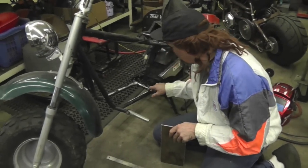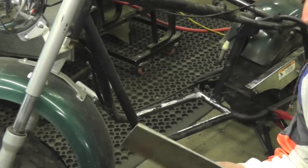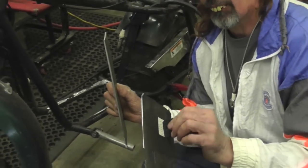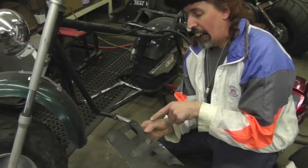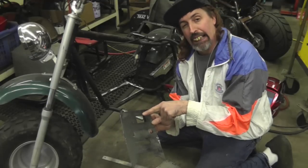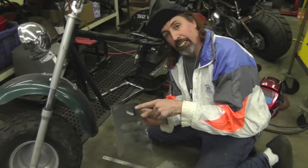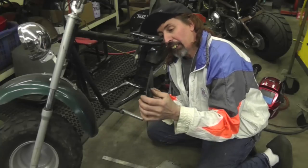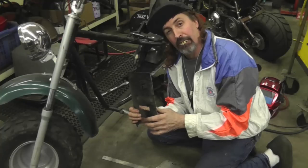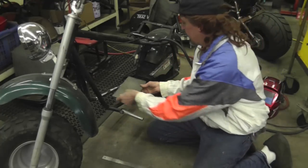Okay, I got that plate all cut out, and I got all the old welds ground off. I'm gonna get ready to weld in my 3/16 of an inch thick engine plate over this cardboard one they put on there. Now, that old engine mounting plate had this on there, and that's to help support that torque converter or that jack shaft setup they had on there. Well, I'm gonna make a new one of these to support that jack shaft part of the torque converter part. I had to round off my corners a little bit to get it fitted in there.